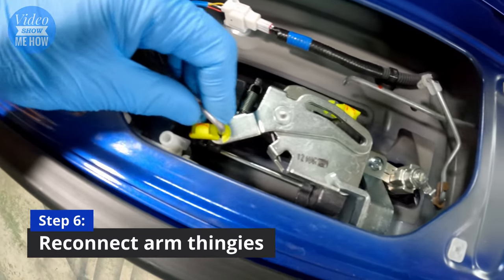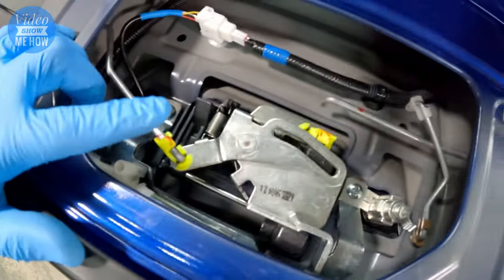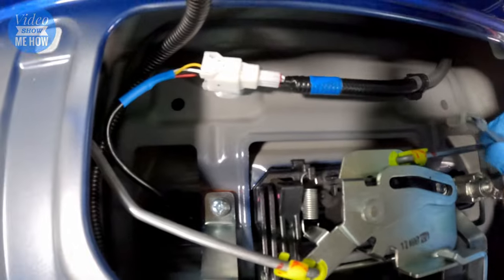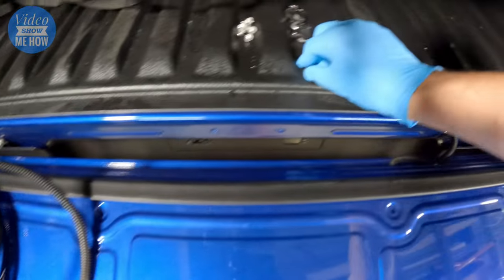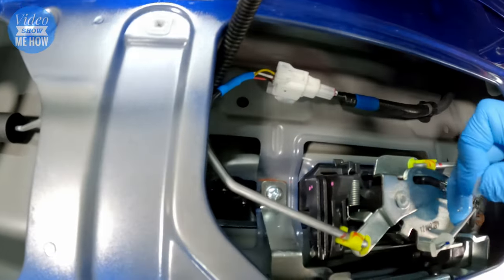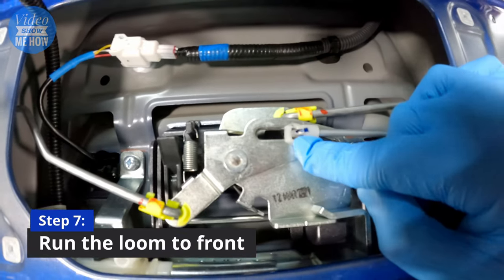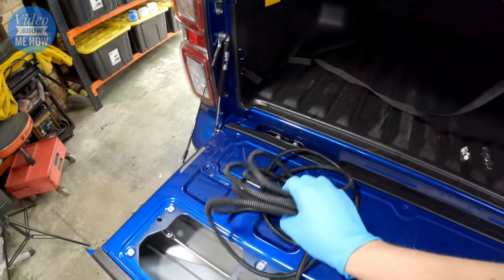From there it's about reconnecting each of the rods. These don't need to be infinitely tight — just regular tight, and that's our bracket in. Connect each actuator rod: push in and use the little retaining clamp plastic piece. Drop it in there and clamp it around. The final rod slots in there — don't forget to use your washer as well, that needs to slot onto the back side. You can see there's little ribs in there and the washer will just keep that locked into position.